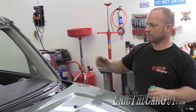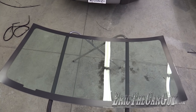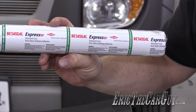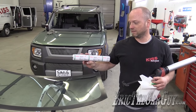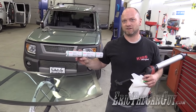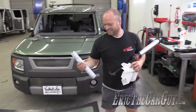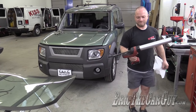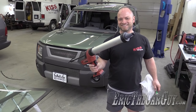Now the surface around where we're going to lay the windshield is pretty much ready to go. We're going to let that dry and prepare the glass now. This is the glue I use — it's made by Dow Automotive, it's called Express BP. This is what I believe to be the best stuff on the market right now. It has a one hour safe driveway time down to zero degrees. It's pretty expensive, but I'd rather pay the cost than have poor quality work. And this is the caulk gun I use — it's not the size of your caulk gun, it's how you use it.